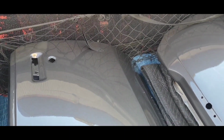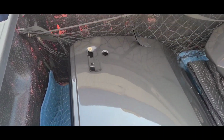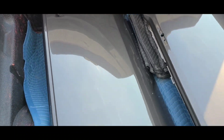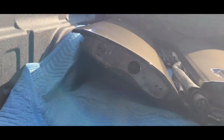But there are other little areas. If you look down at that door good down there, it's a big dent right there, like big. It's one of the dents that we were having discussions about when I was in the midst of the body work. If you go back to some of my videos, I was pointing them out to him and showing him which dents to get. Not which dents, but all the dents. And he tried to fix some. He put metal in a lot of the spots, because the doors don't have body putty on them. It's got a real skim coat of filler, but it's not like the doors are layered with body putty. This is just metal. And if you saw some of the earlier videos, we took these doors all the way down to the metal. It's just a matter of skill set and the desire to want to get them right.